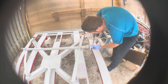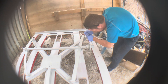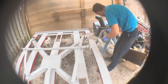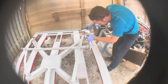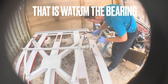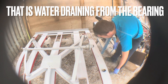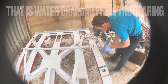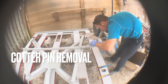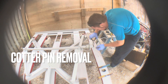The first thing we do is take off the bearing retaining cap. There's an actual special tool to take this off — you can also just use what I used here, which was a chisel. I just lightly tapped it with what I'm using as a hammer, but it's not actually a hammer, it's a pair of pliers — and it pops it right off. Now we remove the cotter pin, or what I like to call it, the hair clip. Then there's the castle nut — there should be a washer, but in this case there was neither on either side. And then you'll get to the bearings and remove the hub at the same time.